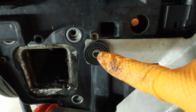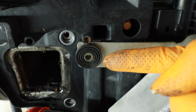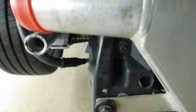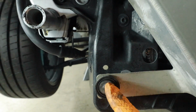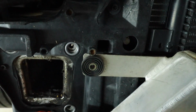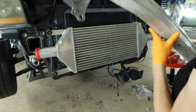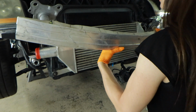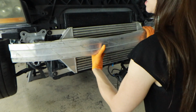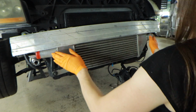So I just discovered my factory grommets in the sleeve work from the stock intercoolers. They transfer right over. So I have one on the bottom with the correct hardware, which is actually the stock intercooler hardware. Now I actually have something legit to bolt it to. Probably put this bumper beam back on now, because I need to use the hardware. If it clears it, good.